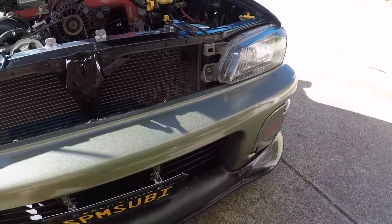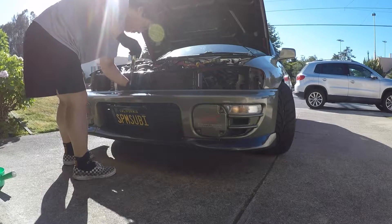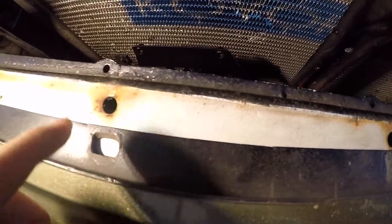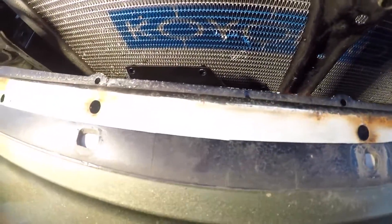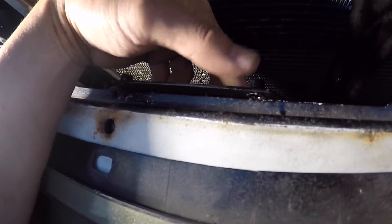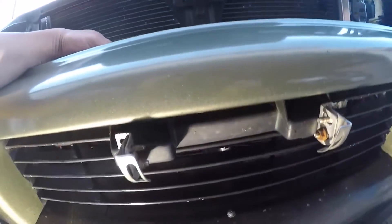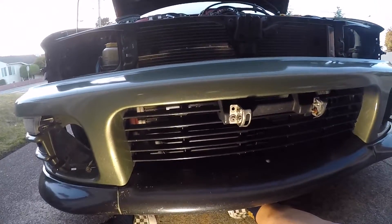So what I'm going to do is make a custom little bracket. I'm going to make little incisions — you can see my sharpie marks — cut there, cut there, and then just bend that little piece flat. Because it comes as a 90 degree, but I need it to be flat. Then I can bring up this bracket and mount it, drill holes through it, and it's not going to sacrifice any rigidity of the JDM lightweight bumper beam. It's going to hang right below, and that's where the oil cooler is going to be mounted.